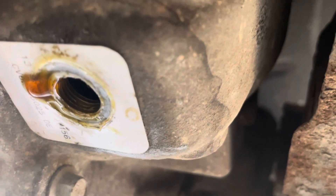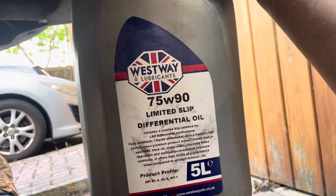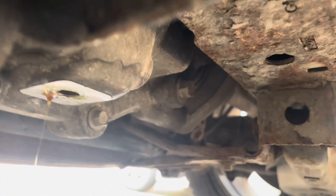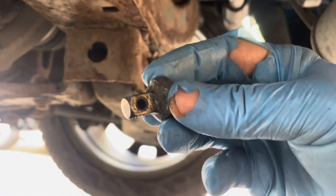I'm just changing it now. You go up the back — we're under the car at the back. Just here, with my finger, there is a square drive plug where you can fill up. You fill it with the oil you can find online; I got mine from Westway, 75W90. Just use a hand pump to put it straight in so it flows back out, then put the plug back in.